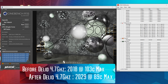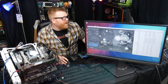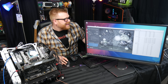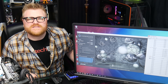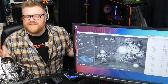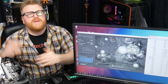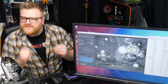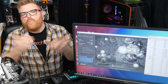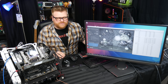We're about 18 degrees Celsius — wait, let's do some math — 14 degrees Celsius. We got up to 89 on the package when before it would go to 103. So 14 degrees Celsius — that's huge, it makes it totally worth it. We're going to be able to go higher than 4.7 gigahertz, but I'm going to save that for another video. This was just to show you apples to apples, non-delidded versus delidded on one of these X299 chips, and basically prove that I can do it with the vice.